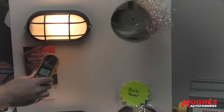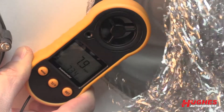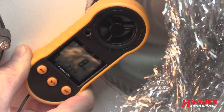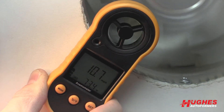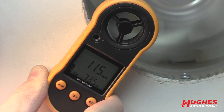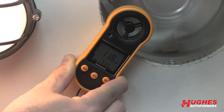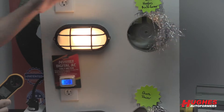I have an anemometer here and you can actually see the difference. On the non-boosted unit I'm getting about 7.88 miles per hour wind speed, and on the boosted one I'm getting 10.5 to almost 11 miles per hour — so definitely a decent amount more push and faster air speed.